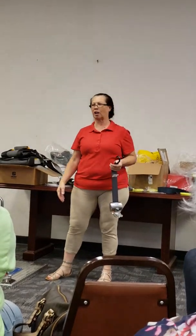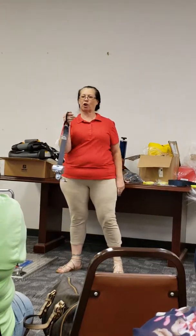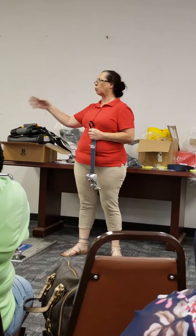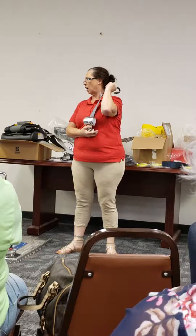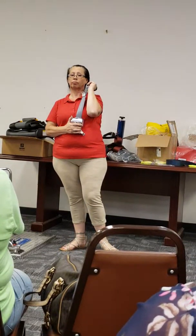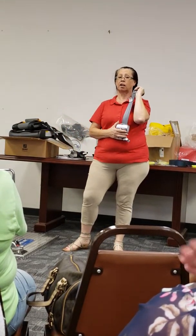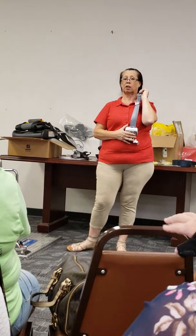On the electric chairs, where would we put the extra set? On the rear. So four on the rear? Four on the rear, yeah, to keep it from going. And that is because of the weight difference. Depending on how much extra equipment, an electric wheelchair can weigh up to 300 pounds by itself. These straps weren't originally designed to hold that. Now they do have brand new kits where you can do only four, because they have bumped up the weight rating so they'll hold up to 600 pounds.